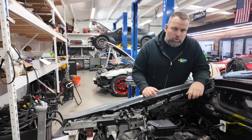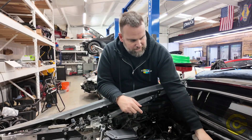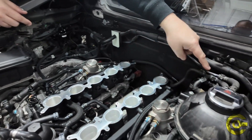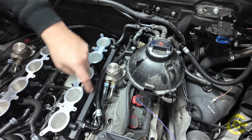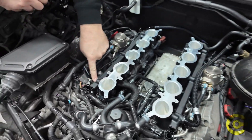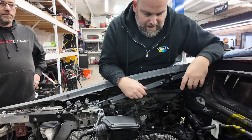We've got another stopping point to go over what Greg's been doing. We've had to reconfigure a few things due to the way this car is configured. We made some different lines for a crossover between the two rails using our BMRS line and fittings — mostly because we were sent something supposed to be a 10-to-10, but the BoostLogic rails are 8-to-8, so we remade that. The flex fuel sensor is tucked in on a bracket behind the coolant expansion tank, then routes around to the rail. Fuel flows out of the filter, to the flex fuel sensor, to the rail, crosses over, then out to the regulator. Greg is also crimping additional lines to run and feed the direct injection straight from the regulator itself — we felt that would be packaged better. Once we get all that on there, we'll finally be able to put the plenum on the intake.